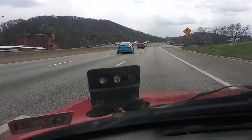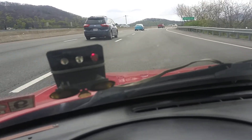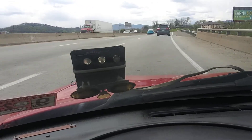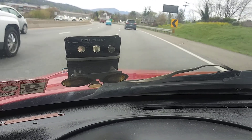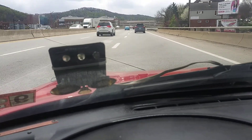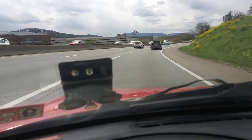So far, so good. I'm going to try to imitate what this thing was doing. I'll do a forced downshift and show you — it would just kick in and out like that. I did that with the gas pedal, but you would go down the road and see that light come back on and you'd be in third gear. Sometimes it would actually flicker a little bit and you'd get an erratic shift. So far, with our resistor in place of the transmission fluid temp sensor, we haven't got it to do that. We're really hoping we've got the problem nailed down now.